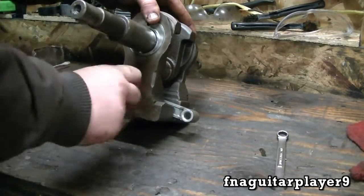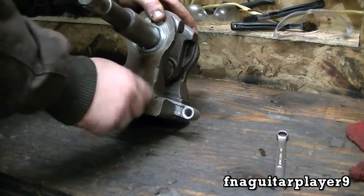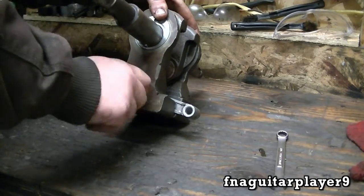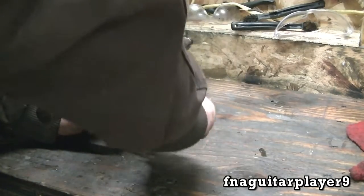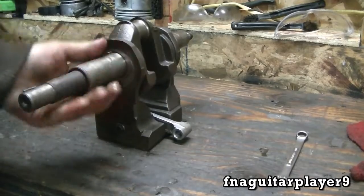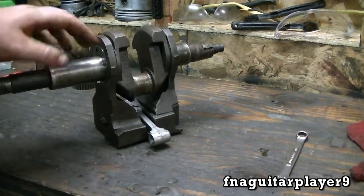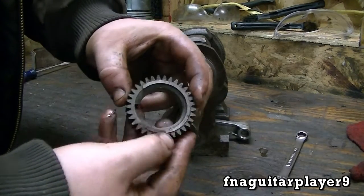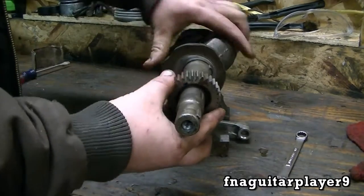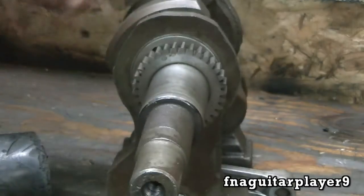And this weight goes in here - you've got to line everything up. Put the bolt back in - I'm not sure of the torque spec on this bolt, I'll just get it pretty tight. Don't get it so tight that it strips out - just get it pretty tight. Make sure everything spins alright. It's making that noise because I didn't put any oil on there - I'll take this back apart before I use it since it's been sitting so long. And your timing gear - the part that's got a lip right here - faces this way. You want to make sure you line up the keyway, and your crankshaft is ready to go.